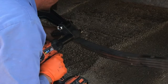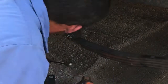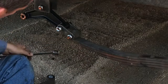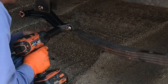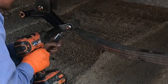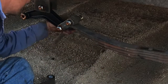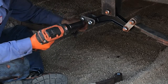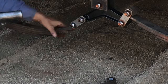When you tighten all your suspension parts down, you're going to take them all the way tight, making sure the knurl of the bolt is flush with the shackle or the spring hanger. Then back it off about a turn or until the suspension parts free float. I did this for each bolt all the way around on every axle — back the nuts off a little bit, then try and move the suspension. If it was still tight, I would back it off a little bit more until everything free-floated. I've seen these left too tight and all it does is give you a worse suspension and wear out all the suspension parts faster.